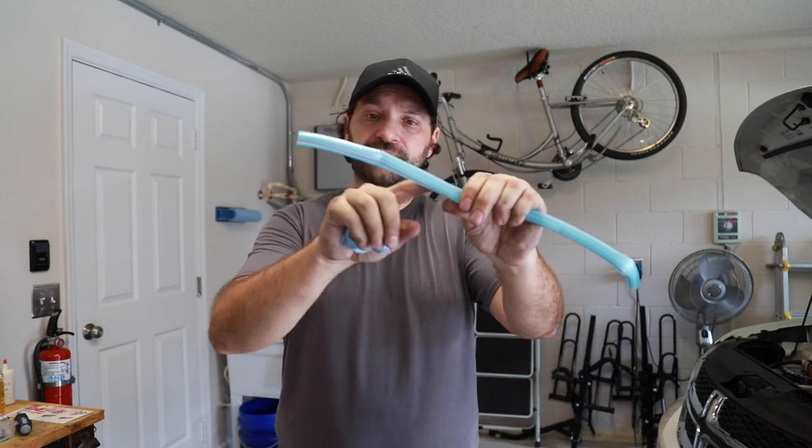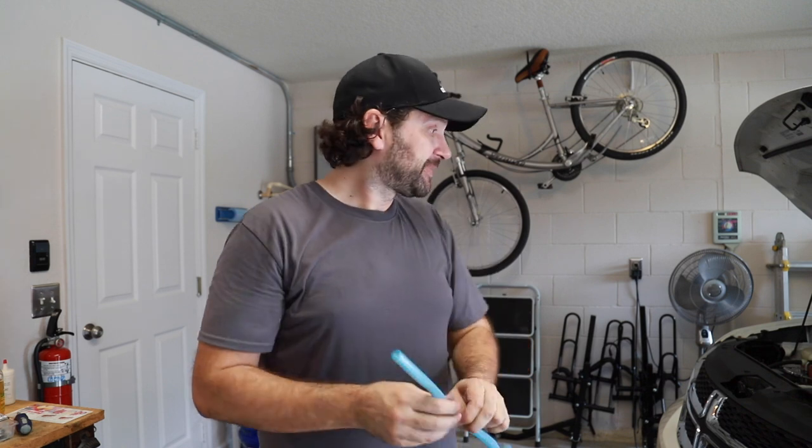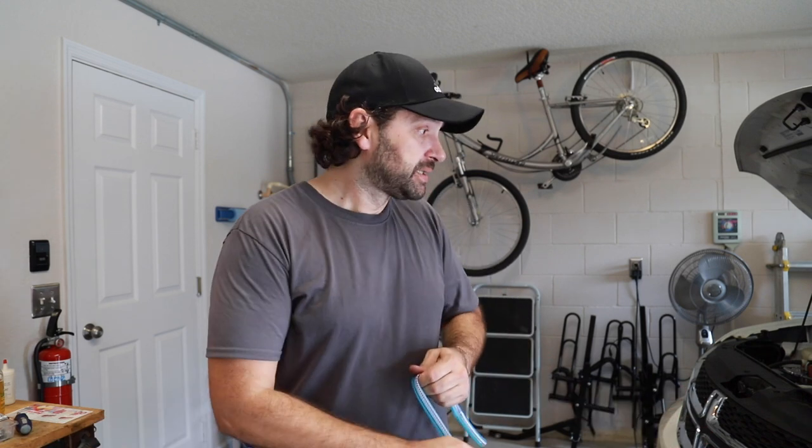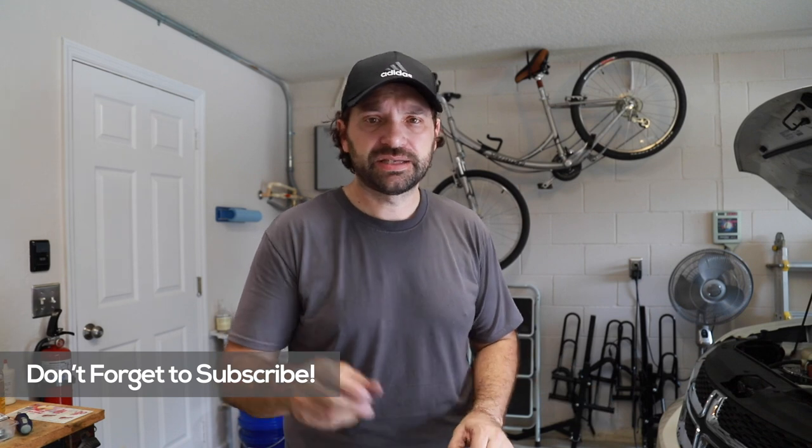The cool thing is I can see if there's any oil accumulation inside the hose. I think this fits best on this car because it is a four-cylinder — when we drive normally, the car revs in regular traffic to 3000 rpm. My car barely gets over two and a half thousand rpm, and the Mercedes in regular driving rarely goes over 2000 rpm. So if you're having a higher-revving engine, especially those little turbo engines — a two-liter pushing 300-plus horsepower — I can see where it's definitely a benefit. On my cars, I think this is the only one that's probably going to benefit, and you've seen how oily it was when I took it off originally. So there's definitely some oil coming out, probably from all the high revving this car does on daily driving. Let me get out of here, clean up, button this up, and we're done. I'll update you maybe in about six months or as soon as this fills up to give you a little update on what happened.